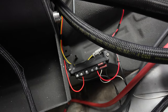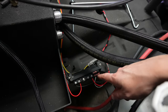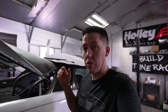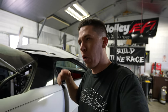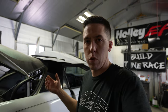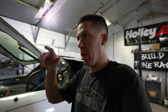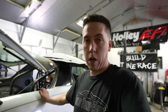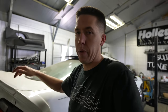I also used one of the little Holley MSD solid state relays back here — one is for the second fuel pump and the other runs the trans cooler underneath the car. These are super nice: they act as the relay and fuse all in one, and if it trips it throws a light so you can troubleshoot. What's really wild is with the race pack and solid state relays, there's basically no traditional fuse panel. Instead of 37 fuses, everything has a digital fuse within the solid state relay. You can even set it to trip at certain amperages in the race pack. Way worth it — I'd highly recommend doing it this way.